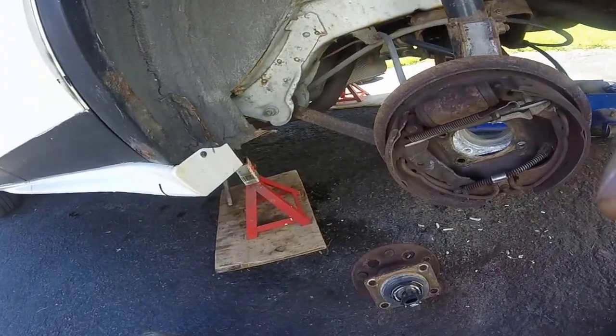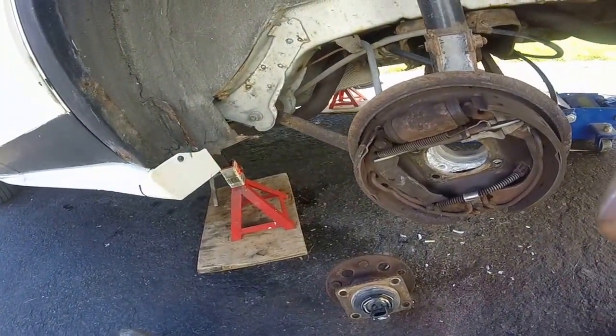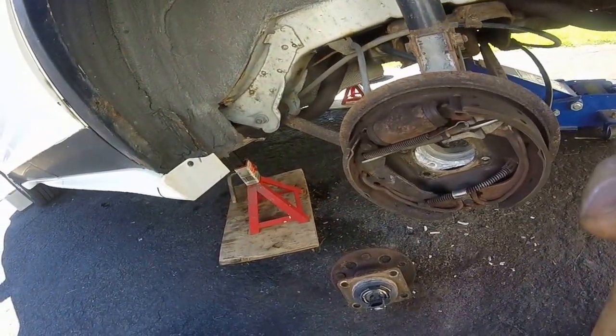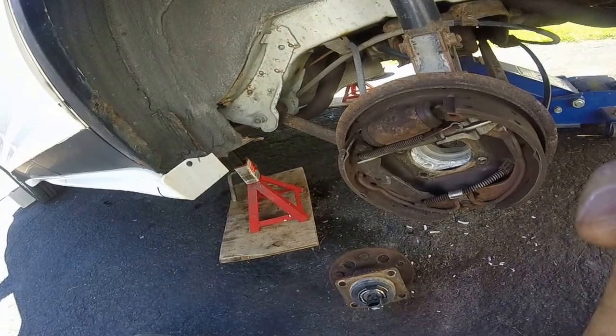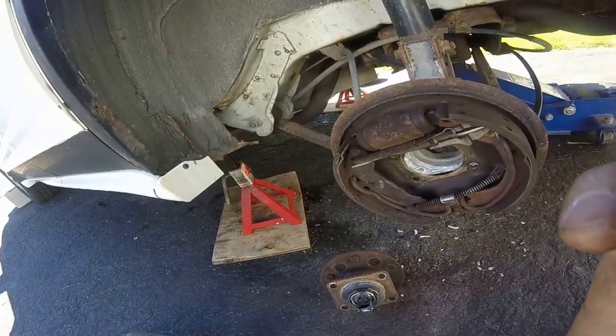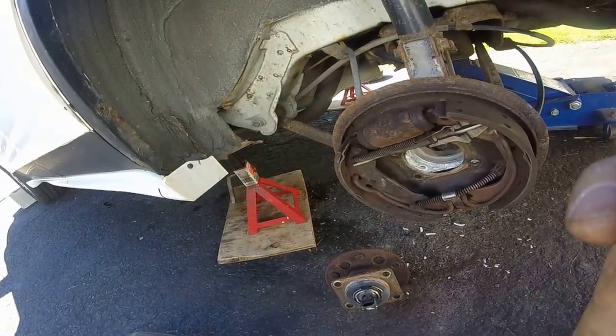I guess as well, one of my YouTube buddies there, Olds Mob 455, real good guy, mentioned about what it could do for that power steering line. Is just you simply cut it and then you put a 6-point socket over it, and that gives you more leverage and everything. So that's an idea for down there.